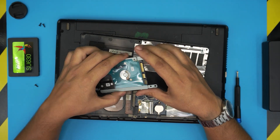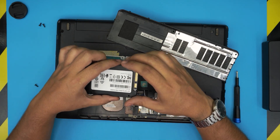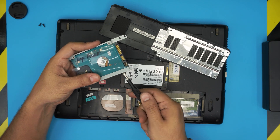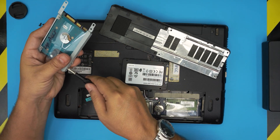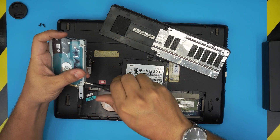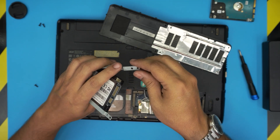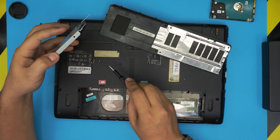This is a 320GB hard drive. We have the SSD in the same orientation — make sure the SATA connector and power connector are aligned in the same position. We need the caddy to hold the hard drive in place. The caddy is held down by four screws, two on each side, so remove those screws and remove the caddy, then transfer it onto the new SSD hard drive.